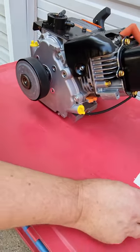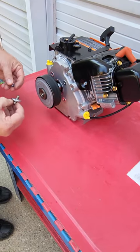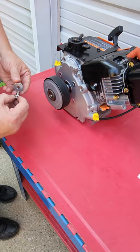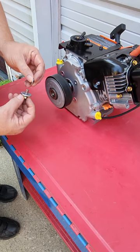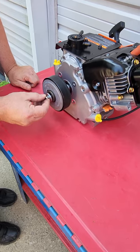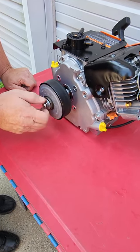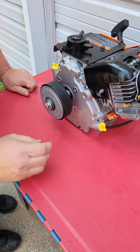What I typically do is take a 5/16 lock washer and put it on the very end of the bolt. So the bolt is going to have a lock washer first to hold it in place, then the retaining washer, and then I use another 5/16 lock washer just as a shim in between. That way it doesn't bevel the retaining washer when you tighten it.